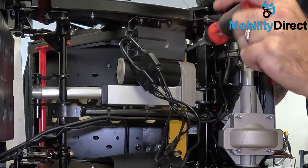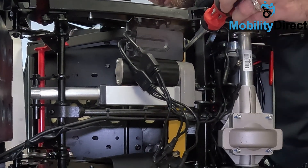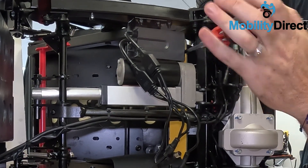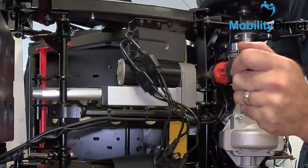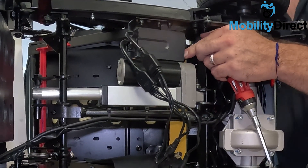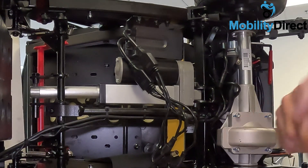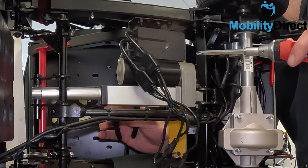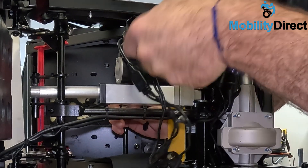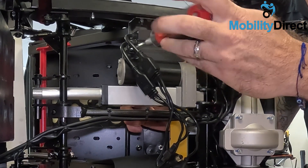Again, take your time — there should be no rush to this. The reason I'm doing the repair on this particular unit is that the remote will not communicate with the control module and the scooter will not fold up manually using the buttons on the back of the scooter. This is a tell-tale sign that this is the main computer to the scooter, so this is what we're going to replace to get it going. It's basically an all-in-one component — it's a nice controller and it's rather easy to work on.